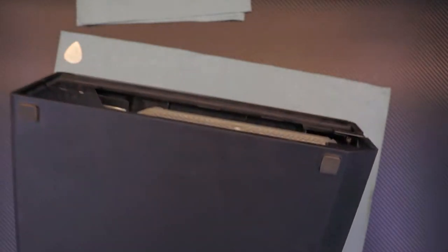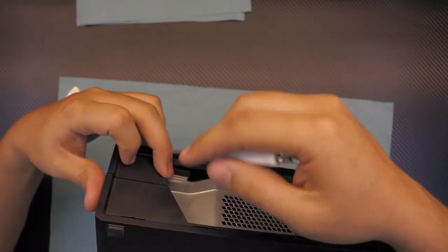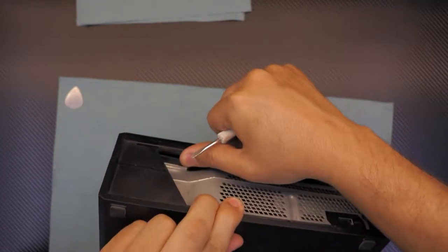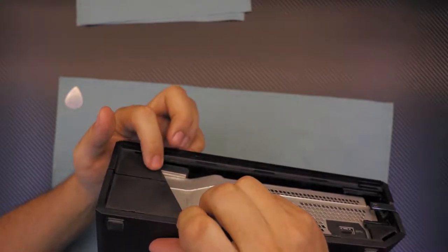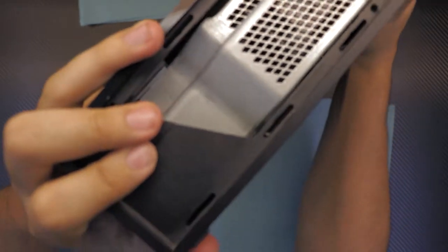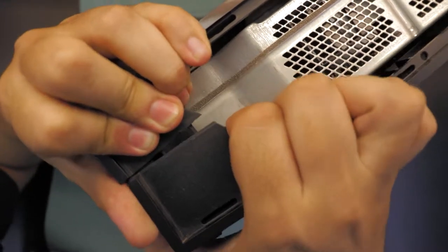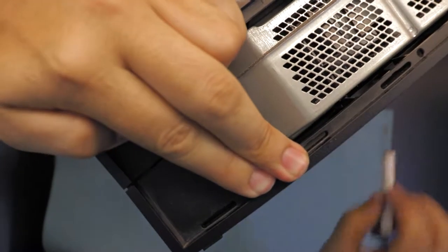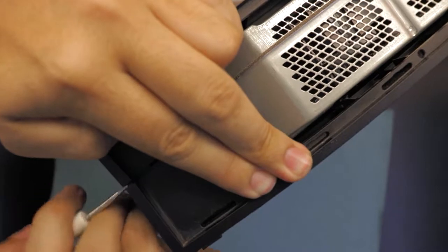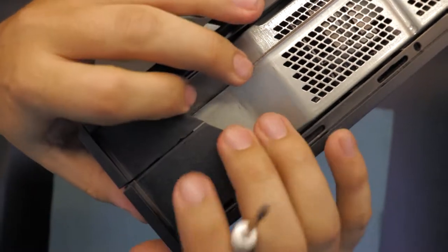On the back side there's another triangle plastic piece. Underneath it there are clips — you have to hold these two apart and pull them apart while pressing the smaller triangle inward and the outer one outward, then pull them apart. Put a screwdriver right at the back here and give it a little twist and you'll hear a pop sound — that's just the locks releasing.